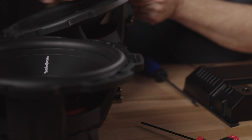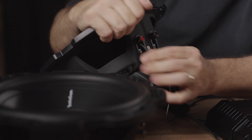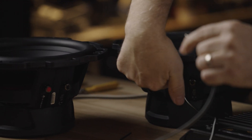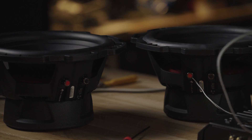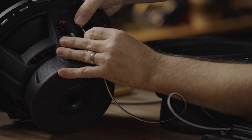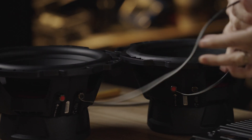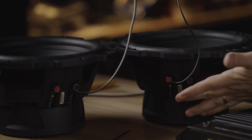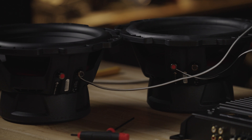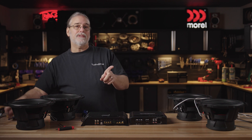So on our first sub, we'll take our positive and connect in there. These are spring clips, so they're pretty easy to use. We're on the red terminal here - that's the positive. That means in series, I need to hook up to my negative on the other side, the second sub. By virtue of connecting this jumper wire between the two of them, positive to negative, these have added up. Two four-ohm subwoofers now become an eight-ohm load. And the leftover terminals that I haven't connected anything to yet are what we're going to hook to the amplifier.